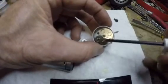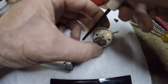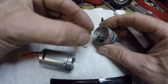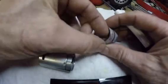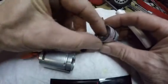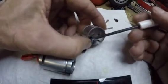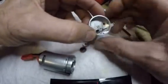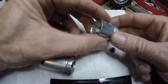So the gears swap back and forth — you've got a big gear driven by the little part of this gear. It's a double gear; the small end drives the big part of the next gear, and then the small end of that gear drives the big part of the next one. The small end of that one drives the last one on this side. It goes clear through the bulkhead here and it drives. There are two pins there, and they'll come out — one of them might get stuck in there, so if you're dealing with that, keep that in mind. Carefully pull that apart.